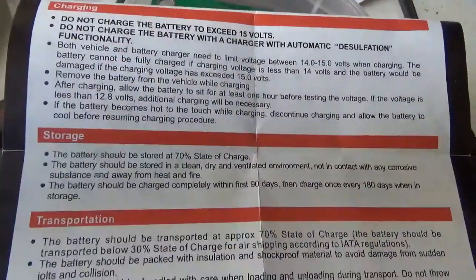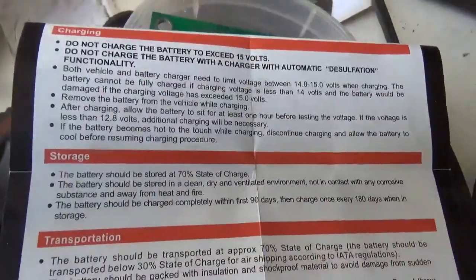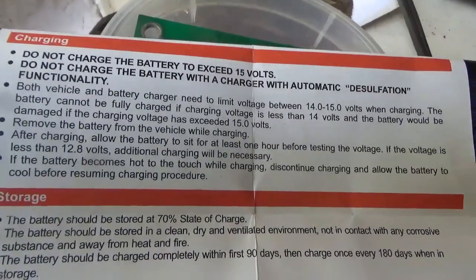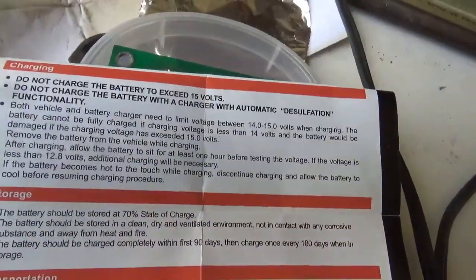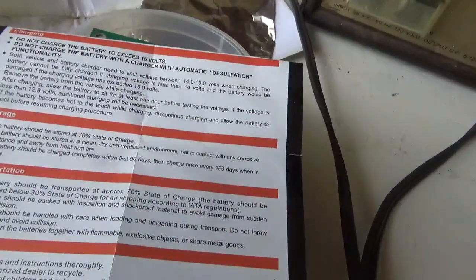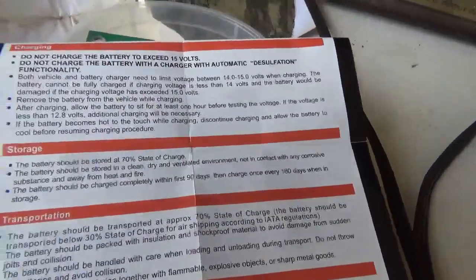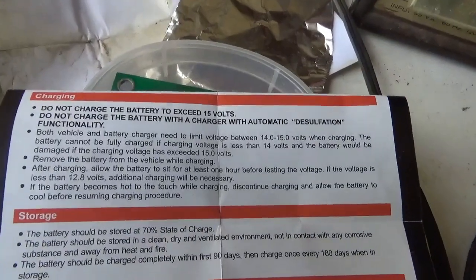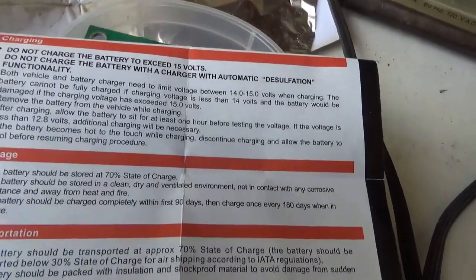Back to charging quickly: the Recon's charging system does not charge the battery over 15 volts, which is good — you won't burn your ATV down. However, it also doesn't quite reach 14 volts; it gets to 13.2 volts. So it's debatable whether the battery reaches a full charge at 13.2. There is actually a charging chart for these batteries, and at 70% charge that's considered optimum for long life.